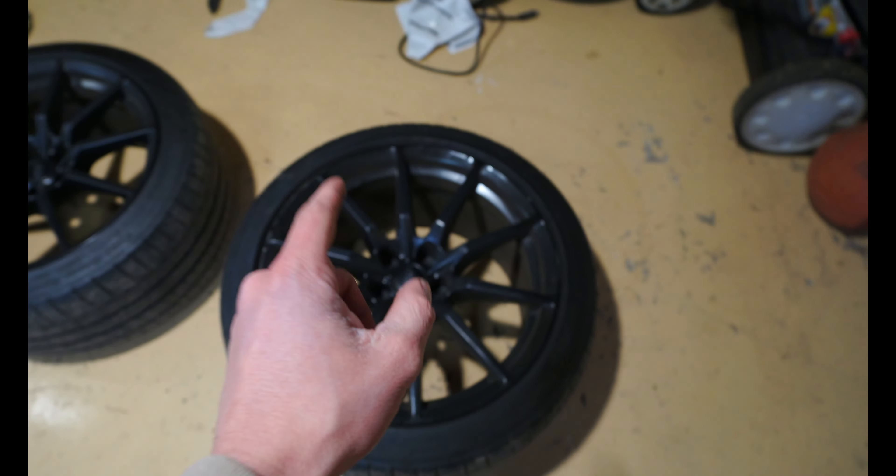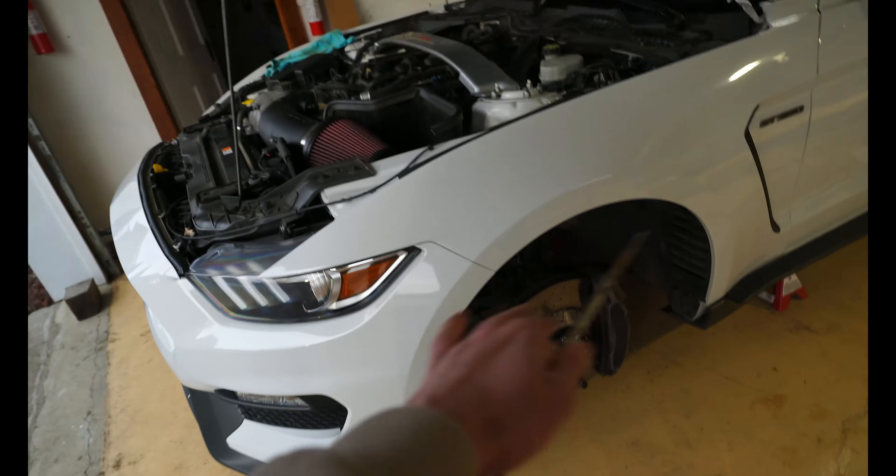I just noticed these are the stock GT350 wheels, giving it the perfect fit right now. Both wheels are removed and we're actually kind of moving along — we got the wheel set out, the fender liner, the under tray, the top bolts on the bumper, and the headlight wiring to go. Now I'm thinking about it, we're not actually moving along. We've got to remove some of these push pins, but I don't think we have to remove the full fender liner — just the bolt right here, so I'll remove the bottom ones and flop it out of the way.